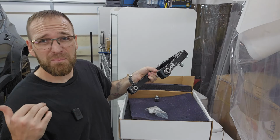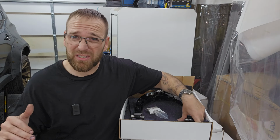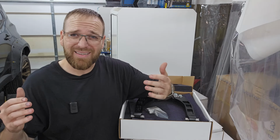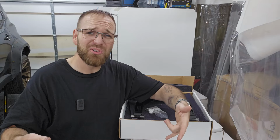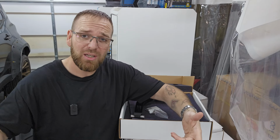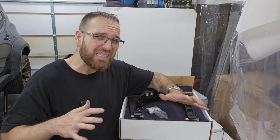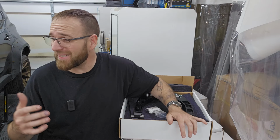Because again, I built this whole car from the ground up. In case I didn't clarify, the front suspension is all Dodge Charger, mostly, highly modified though. I had to take the strut towers, relocate them back about 4.5 inches, along with a lower subframe. I had to fabricate that whole thing myself. I had to keep the motor mounts in the same position, but relocate the arms back 4.5 inches to match the strut towers as well. So there might be some issues here or there. I jigged everything up. It should have been straight, but I'm not sure what's going on.